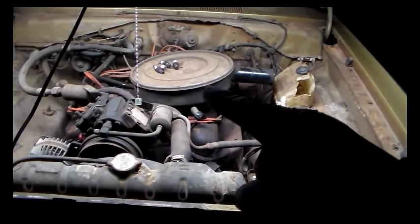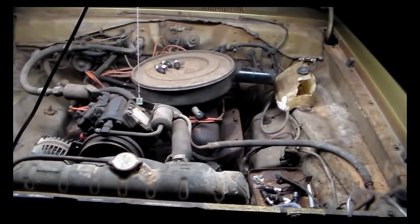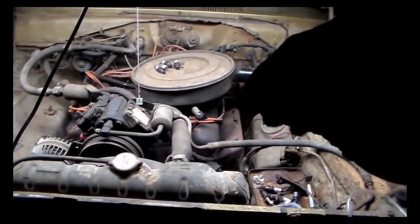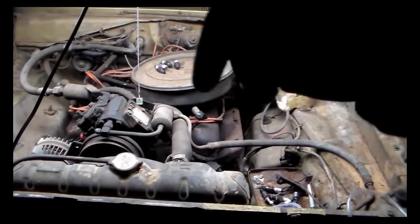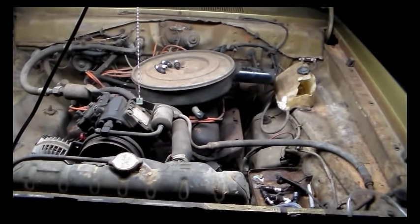And the carburetor's off of it, and when I took it off, it was not stuck. It was not rusty. There's nothing stuck on the external of the engine, like the alternator and anything that turns, it's turning. So it's not that. But when I looked at the bottom of the carburetor, of course it smelled awful also, but it had gelatinous, varnished old gas that had dripped off the throttle plates like it had been flooding badly.